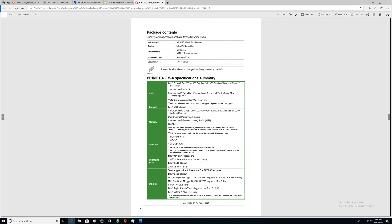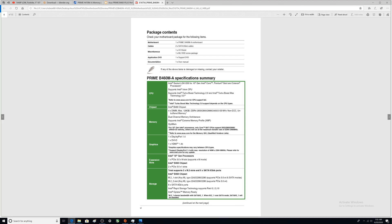Looking at the manual: RAM speed-wise, if you buy 3600MHz RAM it'll tap out at 2933MHz; 3000MHz RAM will probably cap at 2666MHz; and 3200MHz RAM also taps out at 2933MHz. So even though this board has Extreme Memory Profile support, I'm not confident about overclocking RAM on it. I'll have to do more research — all three ASUS B460/H410 motherboards I've reviewed have the same issue, whereas the Z490 had no problem with it.